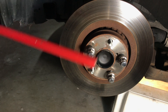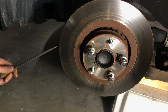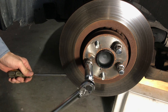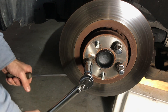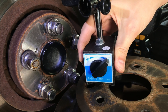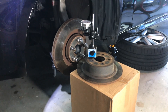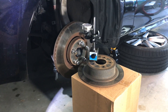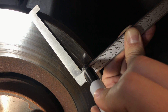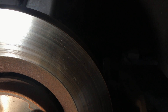For my particular car, it is 103 Nm. Also, if your rotor has air vents in the center, you can use a large heavy-duty screwdriver to prevent it from rotating. Set up the dial indicator tool — I placed mine on the top of a box and used an old brake rotor as a base. Next, measure run-out 10 mm or .4 inches from the outer edge on a smooth flat portion of the rotor.